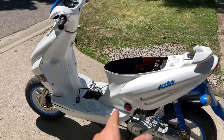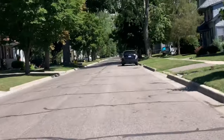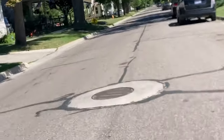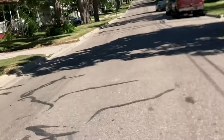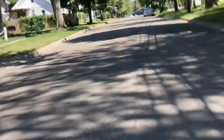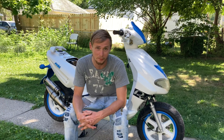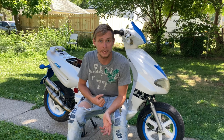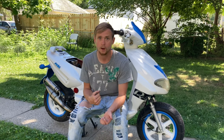The 108 main jet is in the carburetor now. I'm just going to pull around a little bit and see how she performs. This thing absolutely rips — I got it right, when it gets on that pipe it goes! This thing rips, it turns out it's a bit of an animal — an absolute animal. The throttle cable was the issue the whole time. When I yank up on that throttle cable it gets up on that pipe, and when it really gets into it boy she flies.